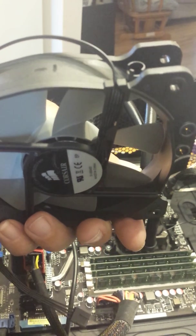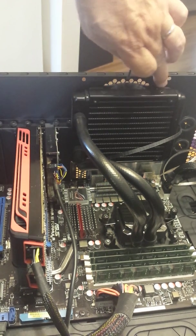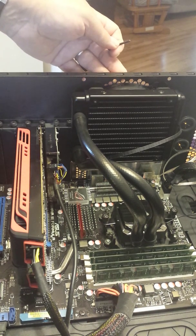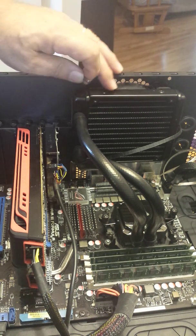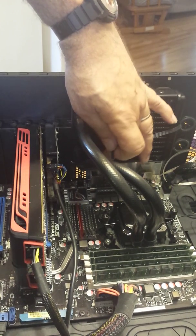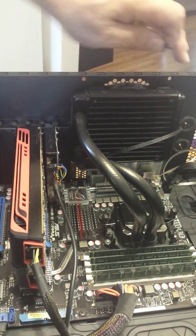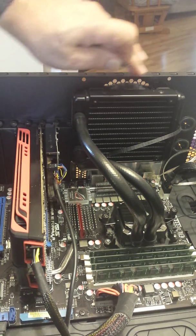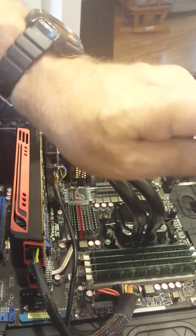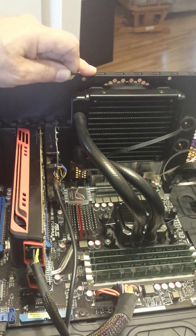I'll stop the video here and put it on to show you. Now the radiator's on with the fan here, and the air is going into the case as recommended. These are the bolts that bolt through the fan in the back into the radiator. Plug the fan in to a fan header here — the CPU is plugged into this, and it's all ready to go. If you flip it up this way it'll be over the top of your case, so it won't fit there — it has to go just sideways so you can put your case lid back on. This is the H60 on the AM3 motherboard. Thanks for listening, have a good day.